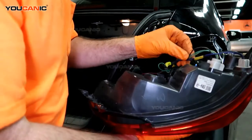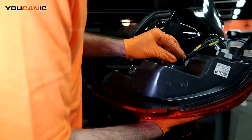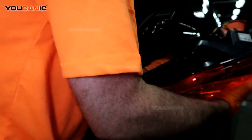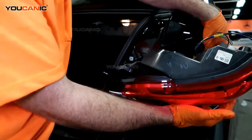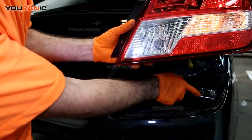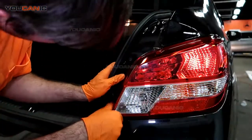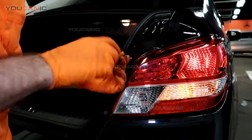So you put those all back in, and just go ahead and re-put these electric into the tab here. Same thing with this one. Hold it into place. And then there was a blue clip on the bottom that'll be better in a picture that you're gonna wanna slide into this location, a little white connector there. And then there was a clip over here. It'll also be in the picture on the how-to. But you get that all lined up in there, and then it'll kind of just lock into place. Make sure that we've got it on that clip. And the blue one, when it goes in, it locks into place. And then you're just gonna go ahead and put these two screws back in, which are just a P2 Phillips screw. Just tighten it up.